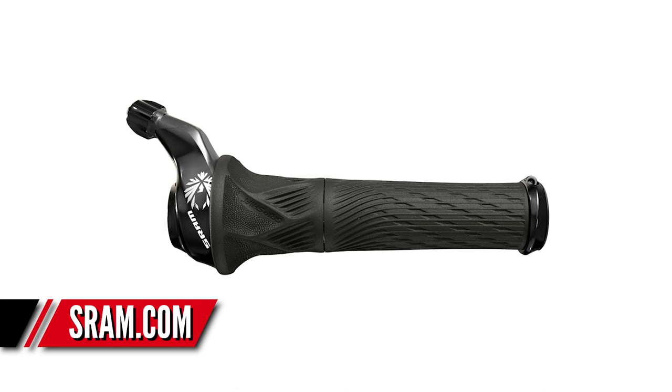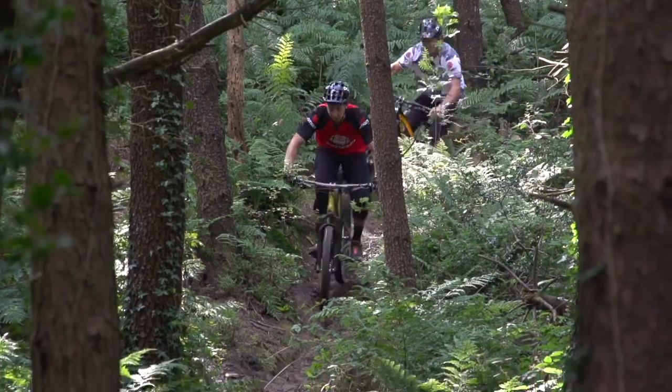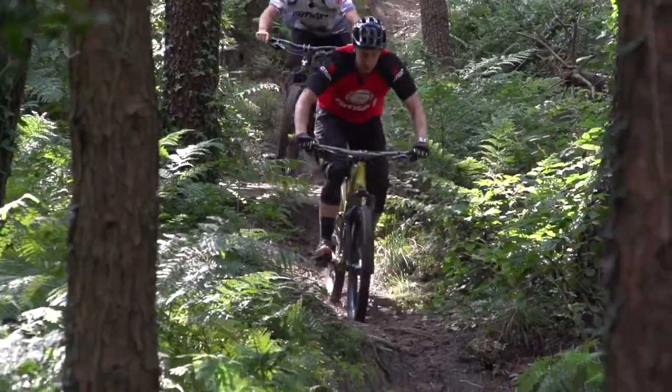As far as the grip shift goes, I actually quite like them. They're a bit odd — grip shift used to be terrible back in the day, put it that way — but grip shift these days is genuinely really good. I've seen it on a lot of XC World Cup bikes. It's super light because it's basically just some sliding parts with a spring system, and it works exceptionally well. I urge you to try it. A lot of people don't like it — it does depend on how you position your hands on the grips. If you like to butt your hand against the flange of a grip, you might accidentally change gear over rough terrain. But they look so neat on a handlebar with no extra pods hanging down — super clean and tidy. Definitely try them.